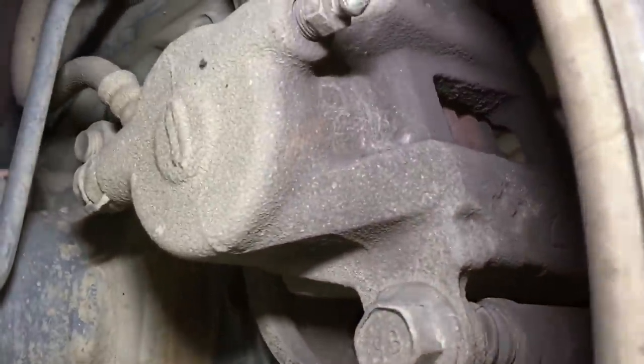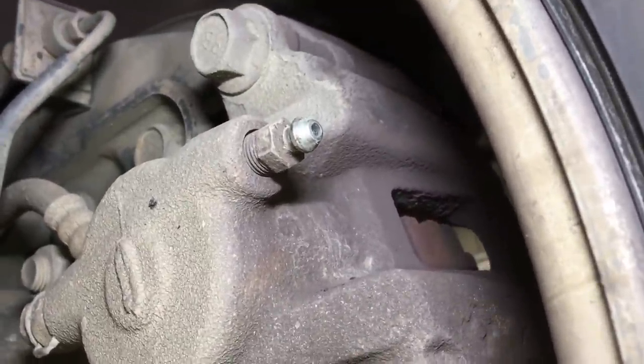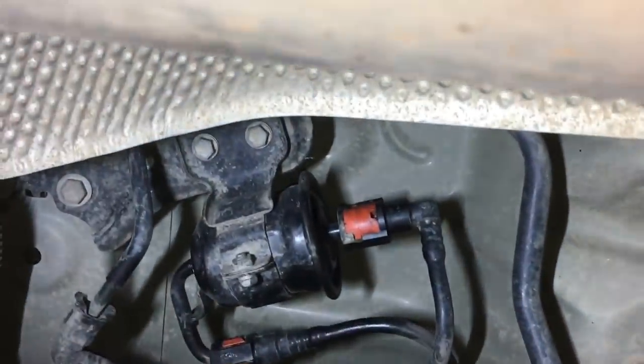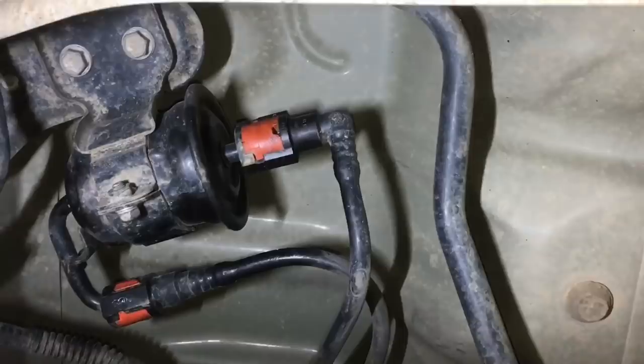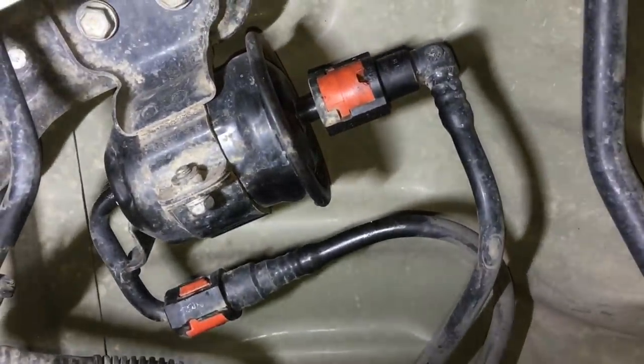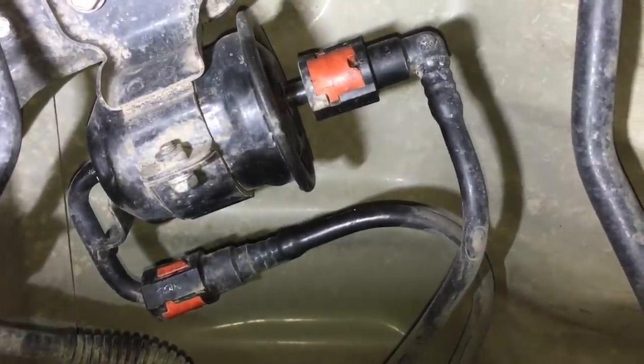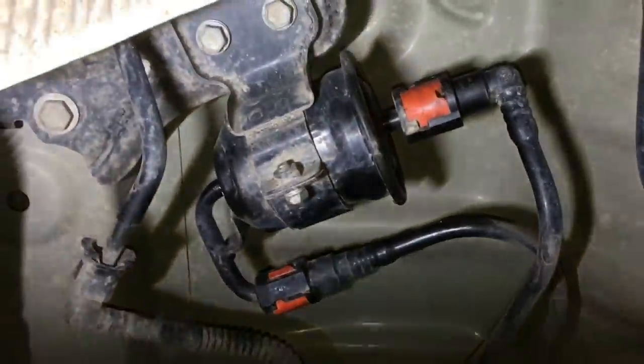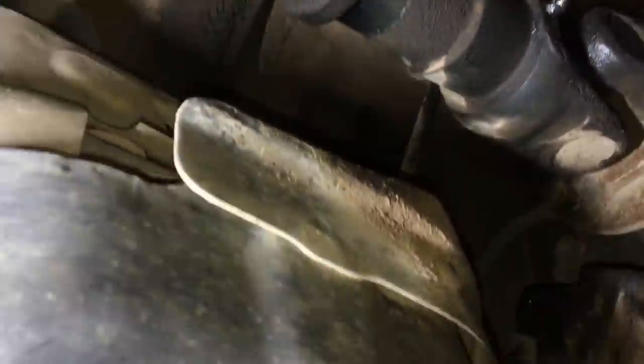Check your oil pickup if you know what that means. This video was mainly about getting the diff plug out. The rear brake pads are pretty low - down to about 20-30% - so rear pads are going on the list. The rear diff oil needs changing too. That fuel filter is about to get changed. Someone's twisted a fuel line - the orange clip is twisted around the wrong way.